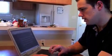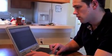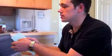So I'm going to scroll down here. Code 15 says coolant sensor high voltage. So there's something wrong with the coolant sensor, and we'll check that out. And then code 44: oxygen sensor, lean exhaust. Okay, so we've got some work to do with our oxygen fuel mix, so we've got to check that out, and then also the coolant temperature. So there you go, error codes 15 and 44. Thanks.